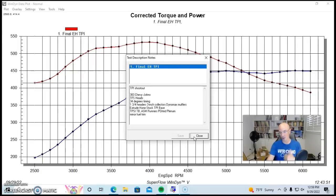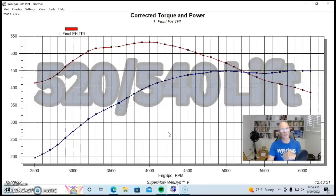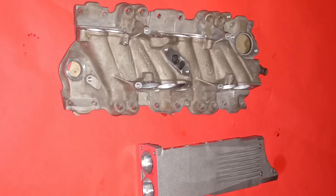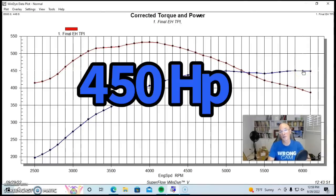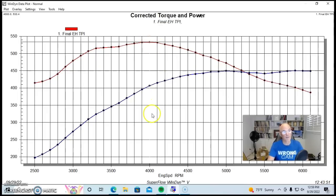I'm going to go ahead and show you what happened. First, I'll put the camshaft specs on screen — it was a hydraulic roller, a pretty healthy camshaft. Run with our ported TPI lower manifold, the big tube runners, a modified plenum, a bigger throttle body, and long tube headers, our 383 produced 450 horsepower — 449.9, so as close as we could get to 450 — and big torque: 533 foot-pounds.